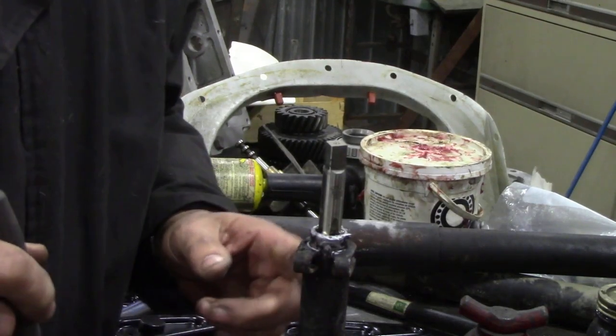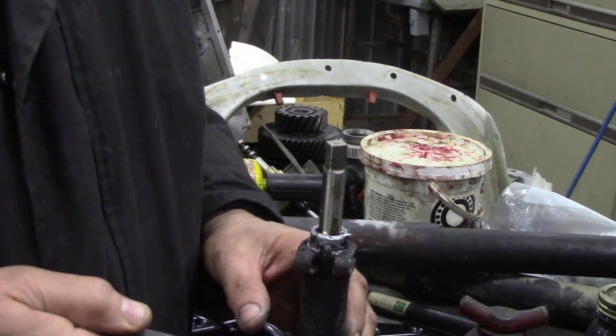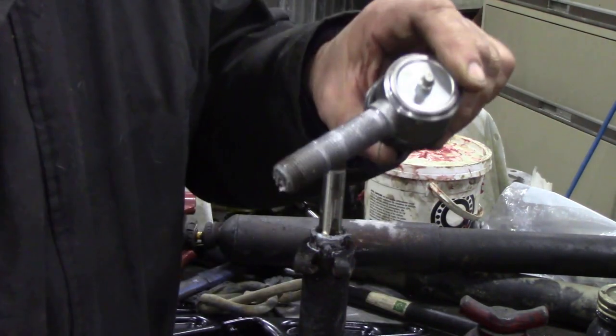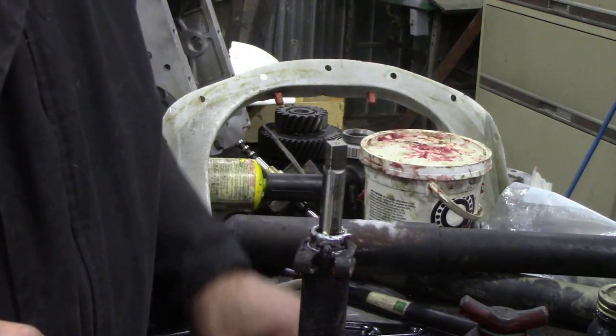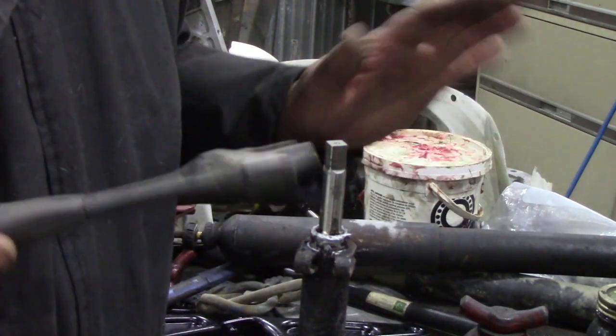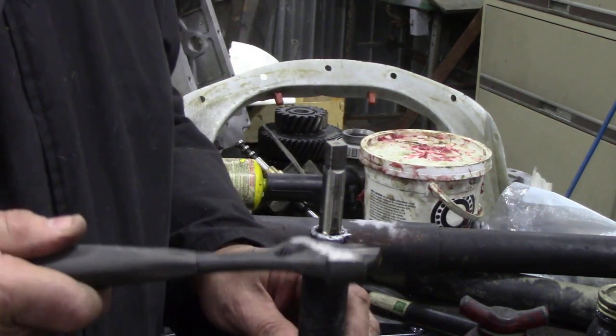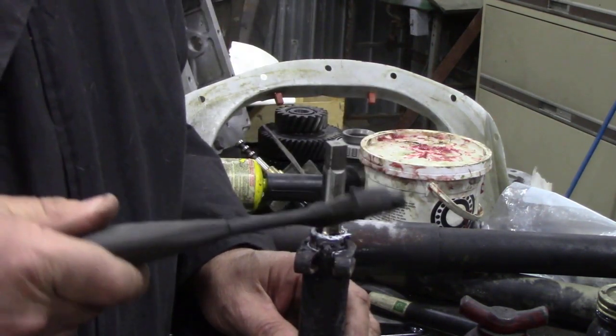If you can remember this front drag link, this heavy duty drag link, I couldn't get the track rod end in, the right hand thread. There's lots of suggestions about how to clean the thread out, which I already sort of knew, but this really needed a tap. And I waited a bit and it just came. That's why I'm in my coat.